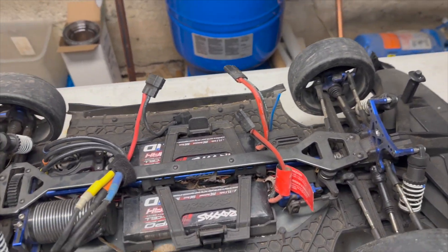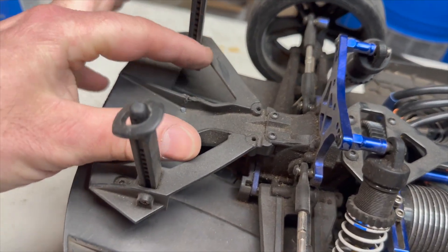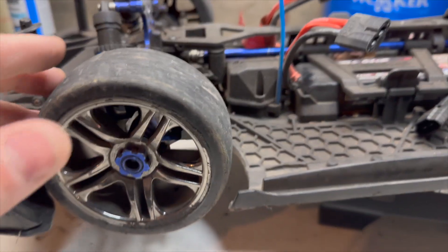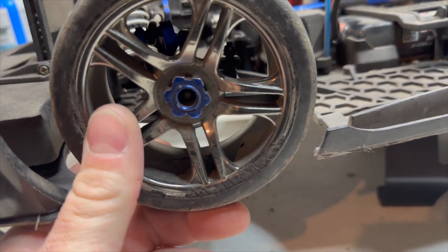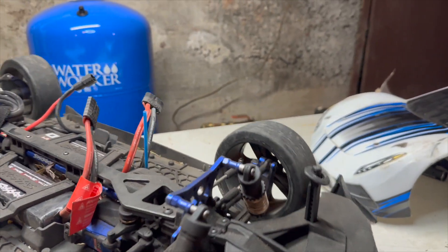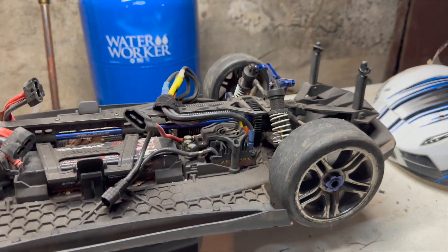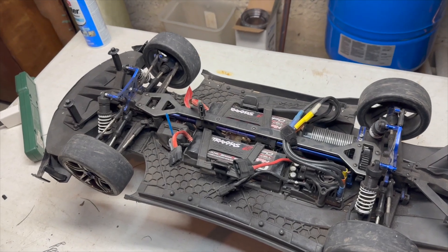Everything is here, kind of. You are missing little things like the pad on the back to support the body - you can see this thing's been crinkled in the rear bumper support. This wheel has a little bit of free play in it, but this other wheel has all the free play and it's because they're missing the little Allen screw that secures the axle. The bearings are probably also shot. The shocks are leaking. Nothing crazy - it's just been used and abused and it needs a nice refresh.